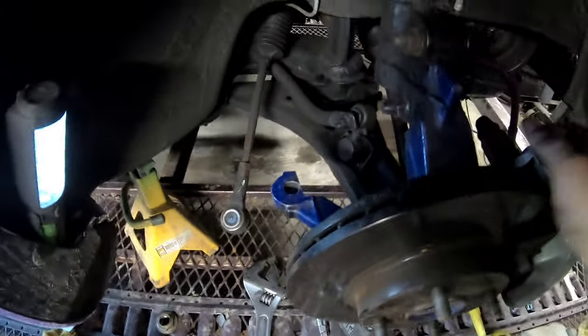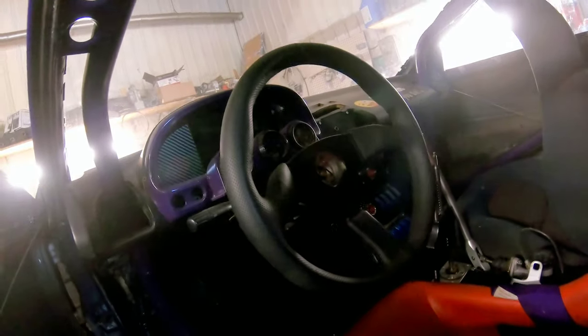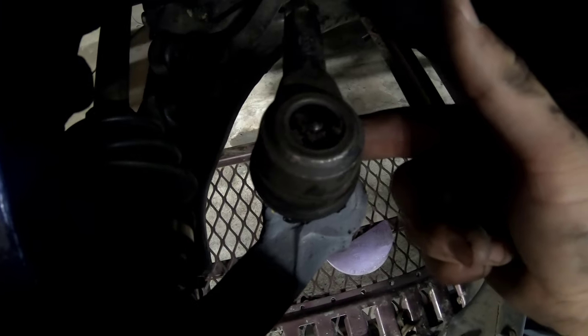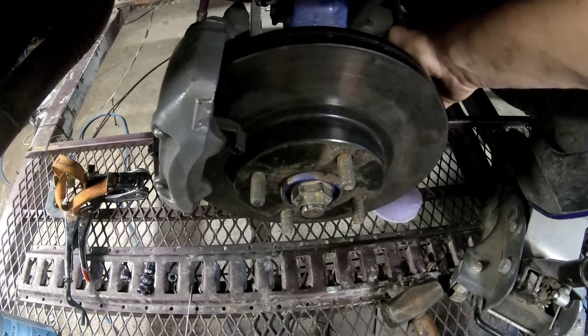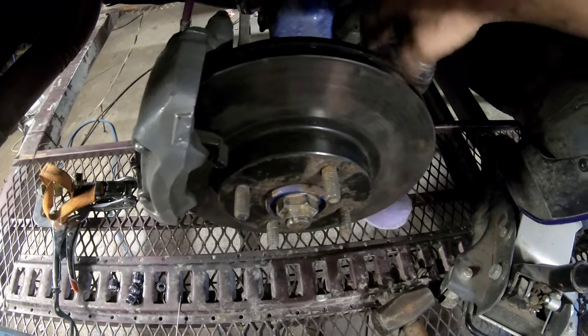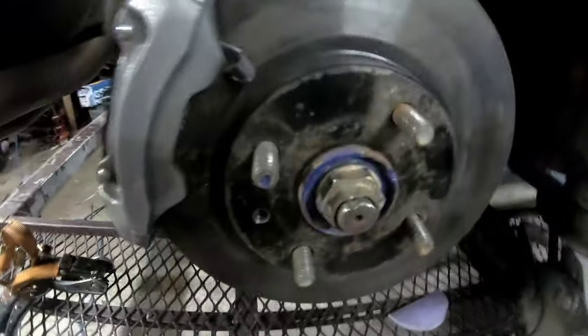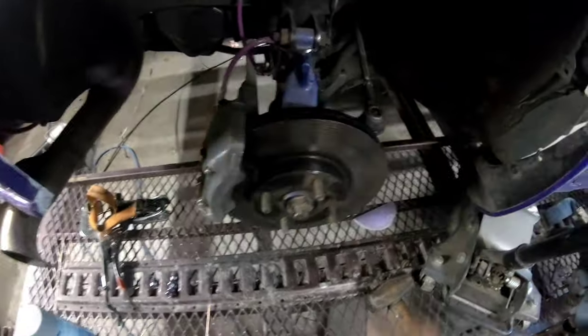I've got everything bolted up as if it were going to be driven, except for the axle which doesn't matter at this point. I've got the steering wheel dead straight. Here are my two holes — I can literally put the tie rod into either hole and the hub does not turn at all. So when I change from the stock position to the new position, there's no movement whatsoever, no change in pitch. If the wheel wasn't straight, that'd be a different story, because this changes the pendulum of the steering.